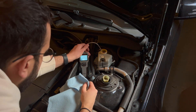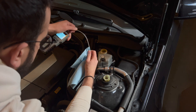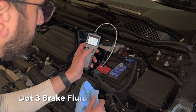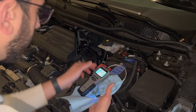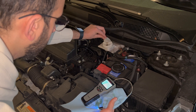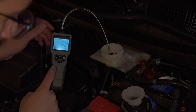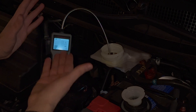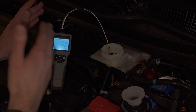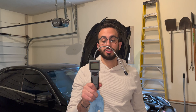Let's be careful and take the probe out. Just to give it another test, I'm on my mom's 2021 Honda CR-V. For Hondas, we're going to switch over to DOT 3. Found our brake fluid reservoir — same thing, there's a screen in here. Let's test this thing again. We are seeing less than 1% on this vehicle. So this thing is pretty versatile — it can check all kinds of cars and different DOT fluids, because there are different brake fluids depending on the manufacturer. I'm loving this device. It is really helpful and really easy to use.